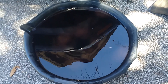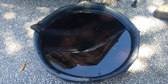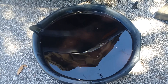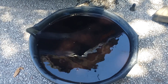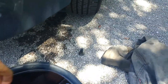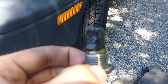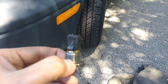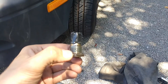Here's what came out — it looks pretty dark and disgusting on second thought, and it's a lot more than five to six quarts; I'd say closer to ten quarts. The Mitsubishi service manual says five to six quarts, so I don't know if it was overfilled. I'll go ahead and properly dispose of this oil. Here's the drain bolt — got a good amount of metal on the magnet, some little fuzz, but not too bad or excessive. I'll clean that off with a rag.